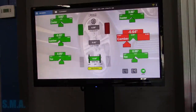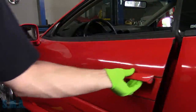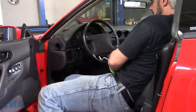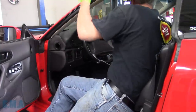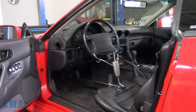Now we'll look at front measurements. Our rear is good; now we'll go after the front camber. Caster is good — don't believe it's adjustable, but we'll double check. We'll set the camber, then set the toe. When doing the front, we want to lock the steering wheel, so we'll stick a steering wheel lock on it. We'll also make sure the brake pedal is still depressed because we're probably going to do the front elevated.